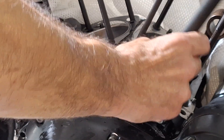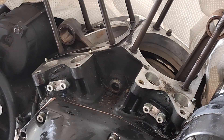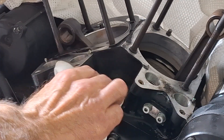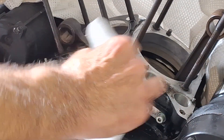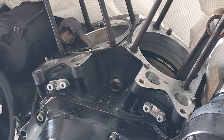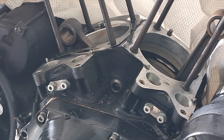I'm going to get ready to fit the rings on this thing in a couple minutes. I'm going to go get another cup of coffee and wipe any excess oil off here. Since I just painted these, I'm not spraying anything to clean them off — it's going to be harmful to the paint. We'll wash it off with hot soapy water once the bike's all back together again. We need to get it off there before we actually run it, because you don't want any oil stains on hot metal — it will stain the paint if you start it up like that.